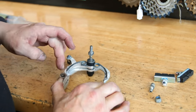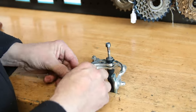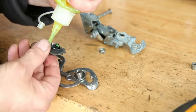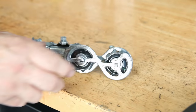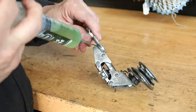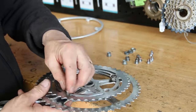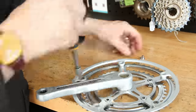We're using a thin oil on any pivoting points. On the brake I even use silicone grease on the slider of the spring just to give that a nice smoothness to the actuation of the brake. We use copper grease on threaded parts. We often get a little bit of criticism about using copper grease, but copper grease is predominantly an anti-seize and anti-corrosion grease — the copper in it is a minuscule mix. It's a great grease on any threaded part; it washes over and sticks to the threads, always giving that anti-seize and anti-corrosion property.